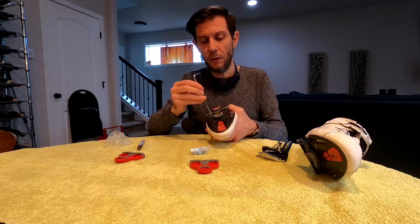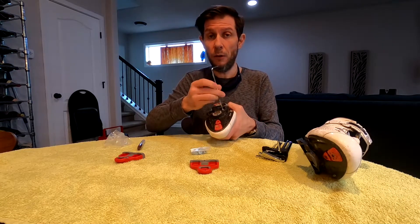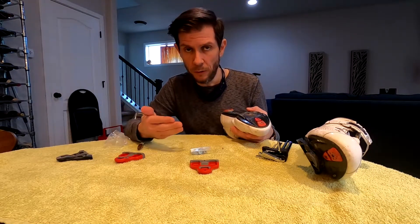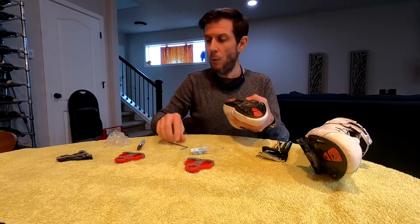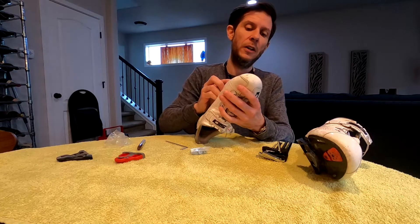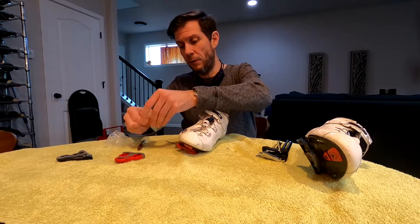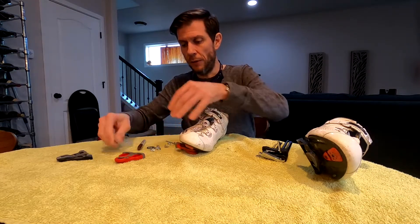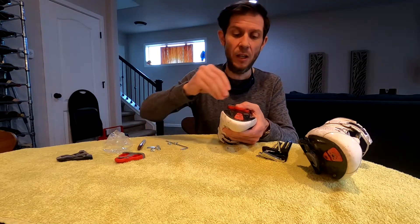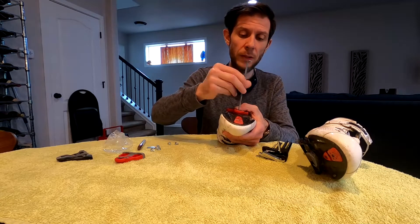The Q factor on the pedals is potentially up to two millimeters different from my existing pedals — that's significant. The upside is I've been considering putting some spacers in anyway because my knee tracks a little to the inside while riding. Now I've got my center markings and I need to line those up with the existing center markings — it doesn't have to be perfect yet, not until I start tightening these down. The screws and hardware for these cleats look to be of sufficiently high quality — looks like a nickel plating, nice and hard, so you shouldn't easily strip the threads.